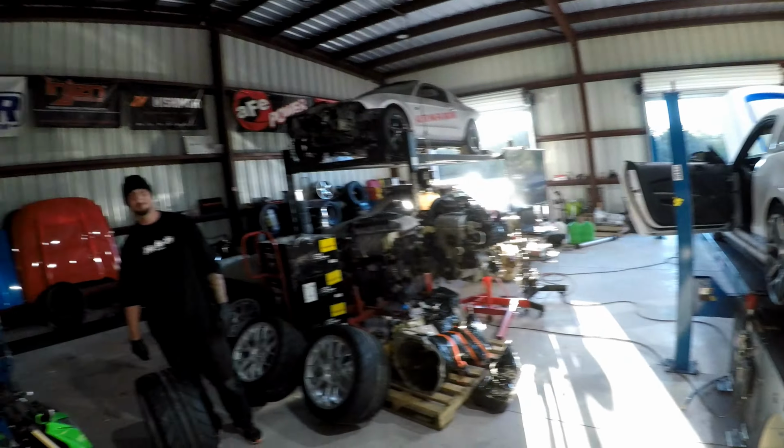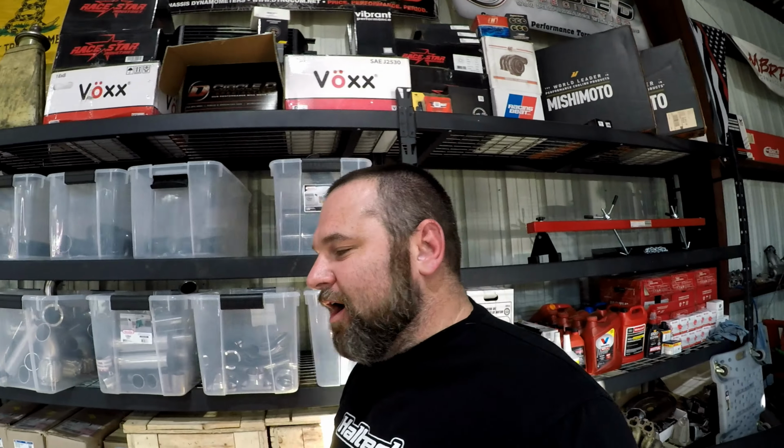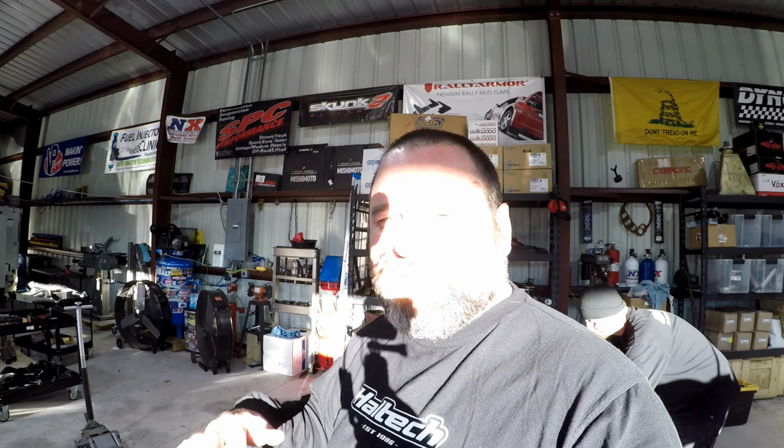Just did a little more cleanup on it. And we're gonna do one more, maybe 2 more pulls on 93, and then we're going to go drive it. Yeah, Tommy's ready for that one. It's our first manual car. So we're gonna go drive it and empty it out of 93, and then we're gonna fill it up with the E85 that the customer brought us, and then we will retune it for E85 and we will up the boost a little bit, and we should easily break that 500 horsepower mark. Probably end up somewhere in the 500 to 550 range and around 500 foot-pounds of torque.